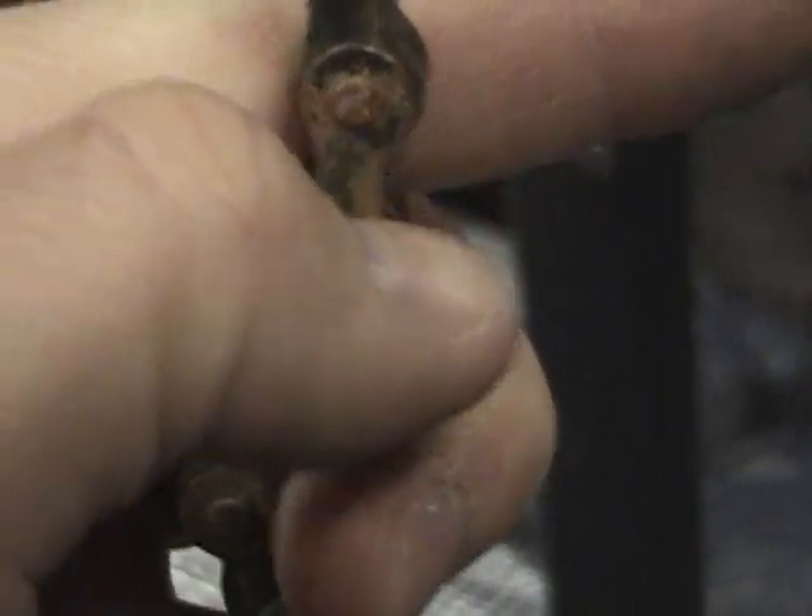The chain does have a bit of surface rust on it, but you can see I'm scraping that away with my thumb and the chain actually is in good shape despite this. Once I have oil on here, you probably won't even see that. I had the chain soaking in degreaser for weeks; I may still spray it down with some brake cleaner one more time, but the chain is still in good usable condition.